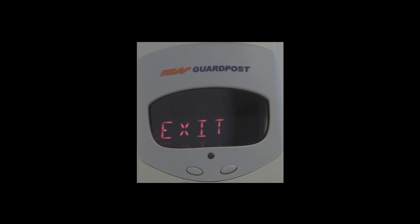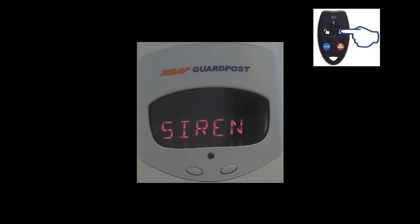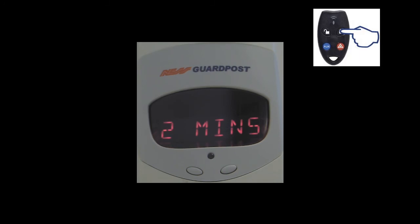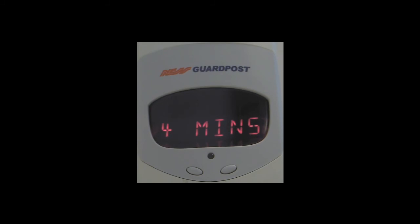Pressing the off button on the radio key moves us to the next option, which is Siren and siren run time. If you wish to adjust how long the siren will sound for from the default of 5 minutes, push the on button on the radio key — this takes you to the sub-menu for siren run time. Each time you then push the on button, it will cycle through the sub-menu, and you can set between 1 and 5 minutes for how long you want the siren to sound. Once you have the time you wish, push and hold the panic button to save your setting.